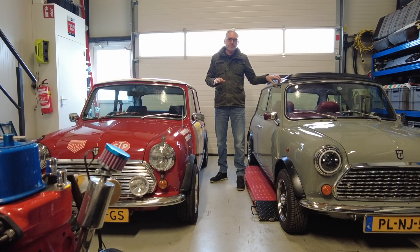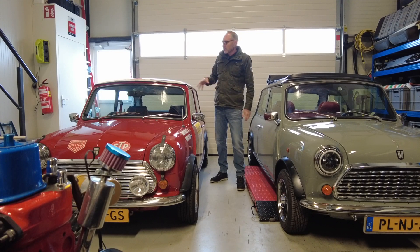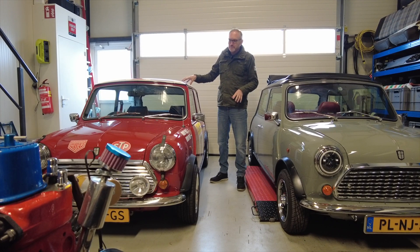This one still has the original cup and rubber cone design from the factory, and this one has actually been set up with coil springs and high-low risers. Honestly, suspension is a personal thing — a lot of people want their car to drive in different ways with different levels of comfort or sportiness. From my standpoint, these two setups both have advantages and disadvantages. The spring one is very good and plush at low-frequency bumps but tends to crash and bottom out when the spring runs out of travel, whereas the cup and cone is the complete reverse — you get less banging and clashing of the suspension but it tends to be a constantly harsh ride.